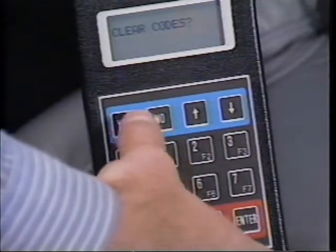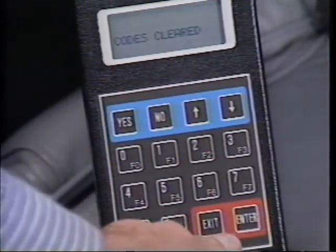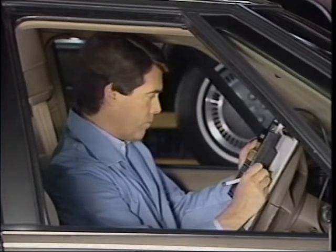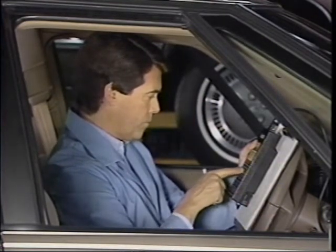On early 1994 vehicles, a code 75 or 76 may appear in the controller. These codes are the result of assembly plant processing and are not true codes. Clear and try to repeat these codes before continuing with your diagnosis. On our test car, code 75 could not be repeated after it was cleared, so no further action was necessary in the diagnosis of this code.